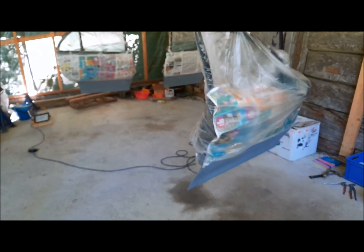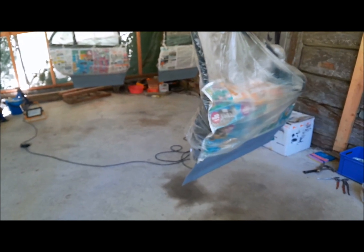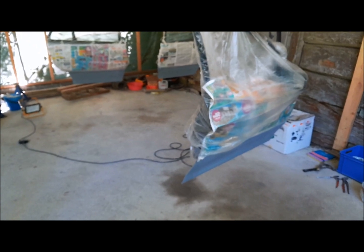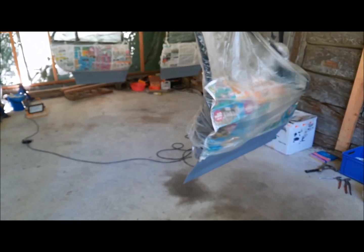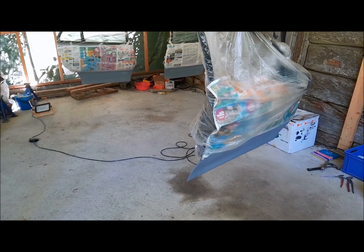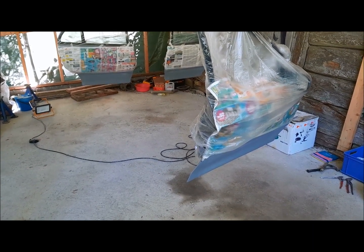The primer work has been done now and there were a few issues while doing it. I got a couple of runs in the epoxy primer paint and the acrylic filler wasn't that smooth, so I need to wet sand all of the panels through. But right now they are ready for base coat and clear coat.